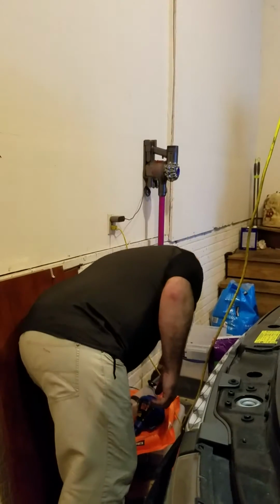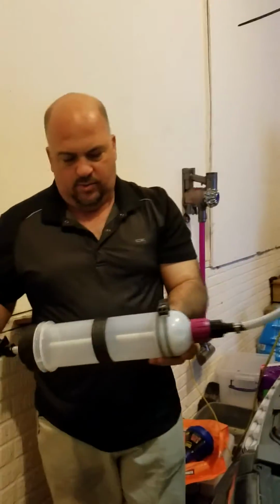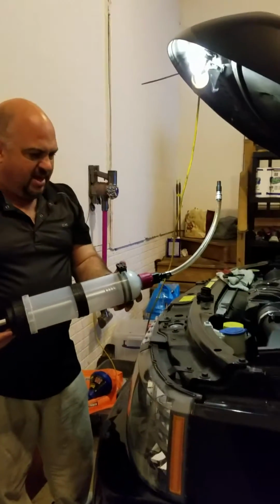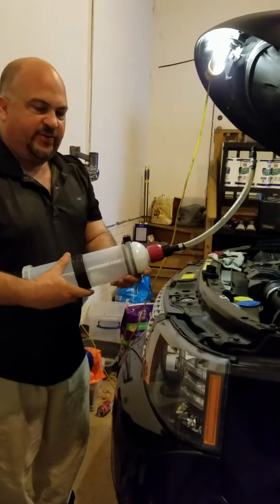Some of the other videos you'll see online, they're using the large Mighty Vac, a really tall pump to evacuate the oil. I have a CTA brand, part number 7077. It's an extraction syringe, pulls out 1.6 quarts at a time, and then we'll just evacuate that into a 5-gallon water jug that we use for waste fluids and stuff here.